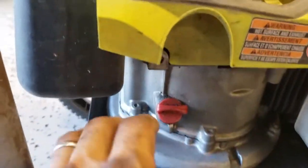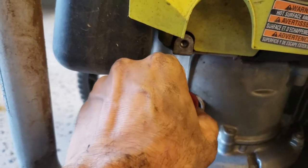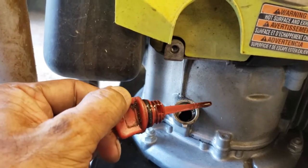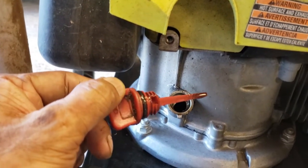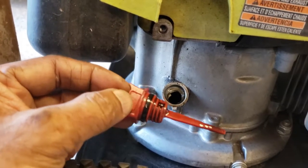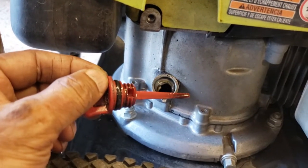So every 50 hours you should change the oil. Here it is. Right, there's no meter on this unit, so you're going to have to kind of estimate how much is 50 hours, or just look at the oil after you pressure wash for many hours. You know, typically if you do a driveway, it'd probably take you 10 hours, so probably every other year.